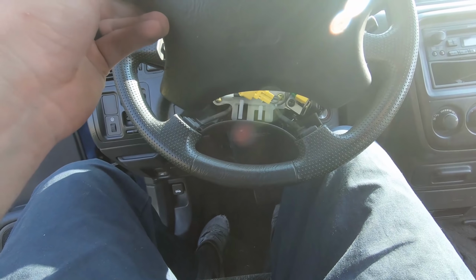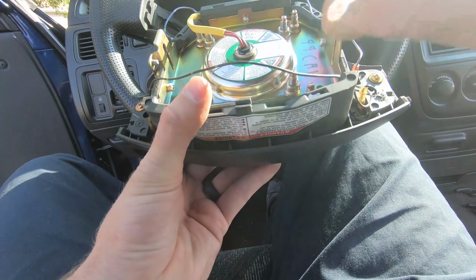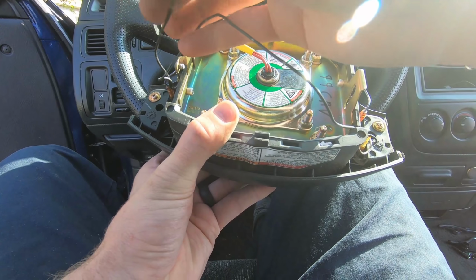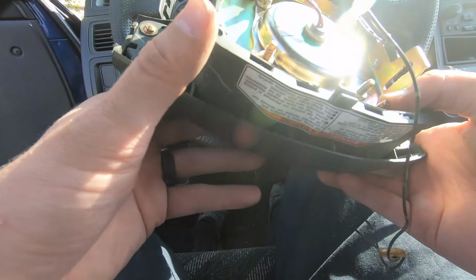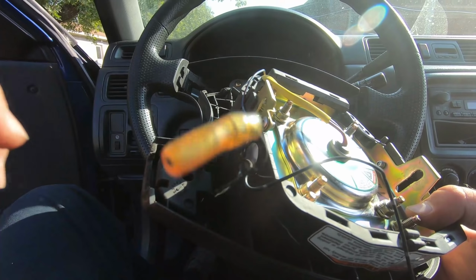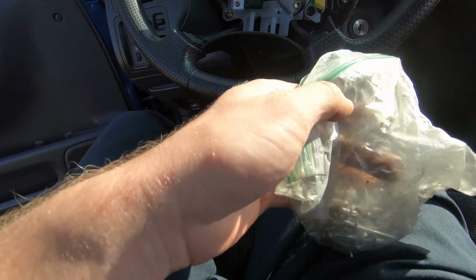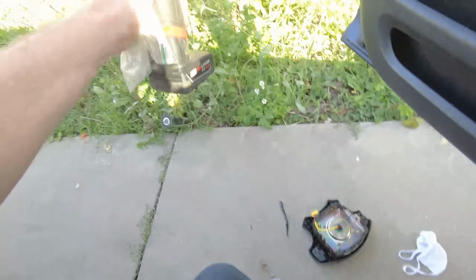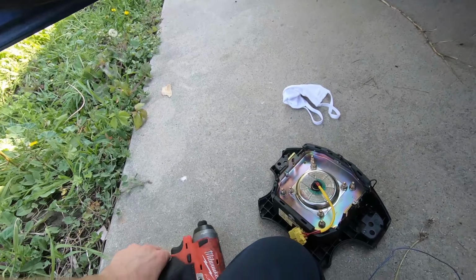Interesting. So it's got to be an issue with that black wire then. But it is riveted in right here, so I'm going to go ahead and just drill it out. And replace it. I'll just put a new rivet in there, so I'll go grab my drill and my riveter. All right, I'm going to do this out here. We'll take this black wire off.